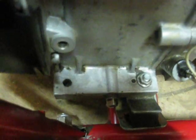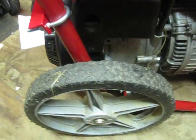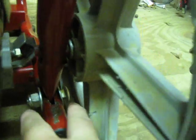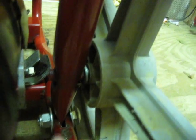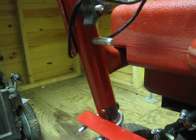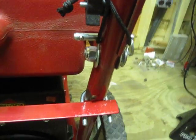On the bottom of the generator there are oil plugs. The nice thing that Briggs & Stratton did with this generator is they have multiple oil plugs located along the sides and along the back of the bottom. So this thing could be mounted in any direction and you can still have access to the oil pan. The other problem was that the welds broke in the frame — it looked like it was carried a lot with some vibration issues. The welds broke right along where the tank is and also on the bottom. So I just put in some carriage bolts and stop nuts, bolted it through. I might weld it later, but for a solution right now, I just bolted it together.